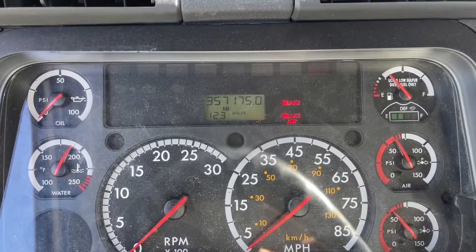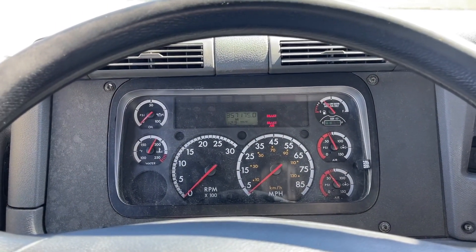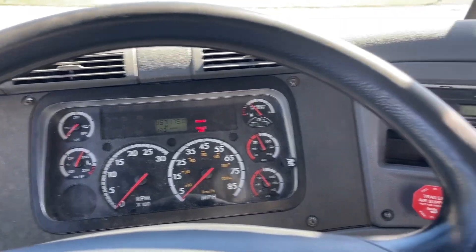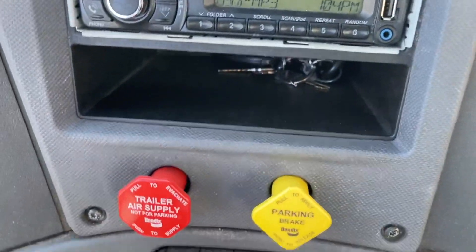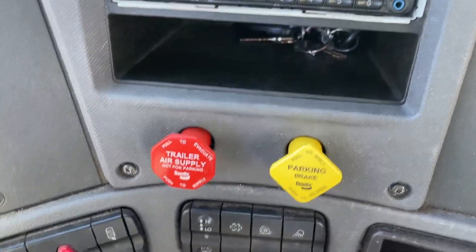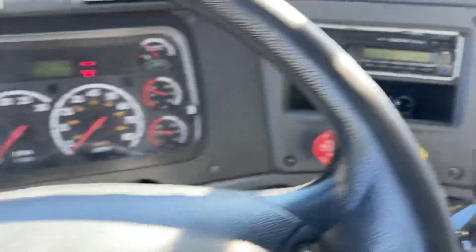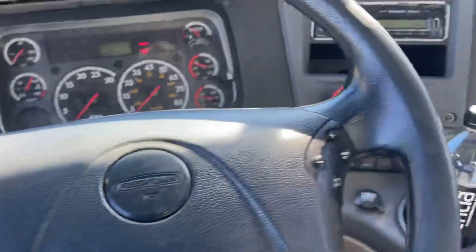At that point the alarm and alarm buzzer will come on the dash and you will hear the noise. As you can see it popped on. I will continue to pump the brakes until the air gets between 20 and 40 PSI, and both of these buttons will pop out. You heard both of them pop out. I just completed my LAB test.